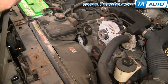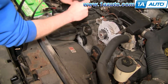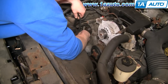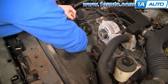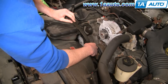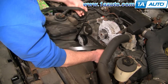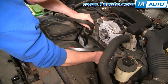I'll try and explain what I'm doing. I'm going to take a loop like this and put it down and around the air conditioning compressor, which is down here on the passenger side of the motor, loop it on there, and then bring that right around my tensioner, and then from there bring this side up and around my idler pulley.